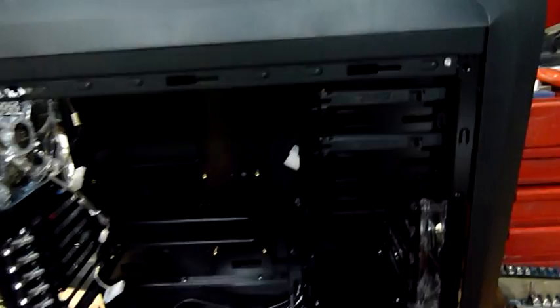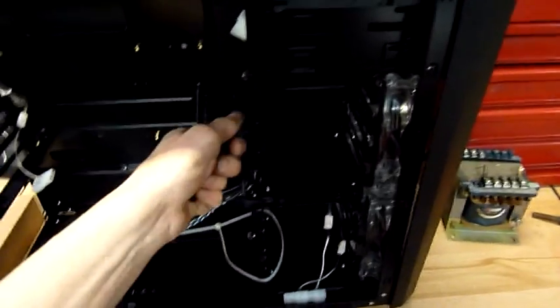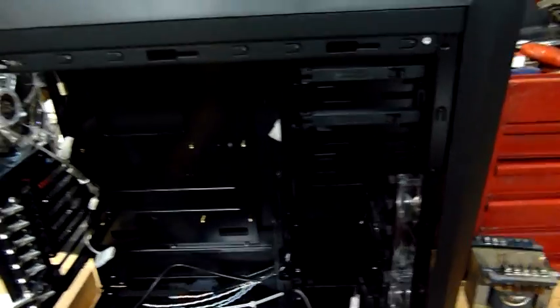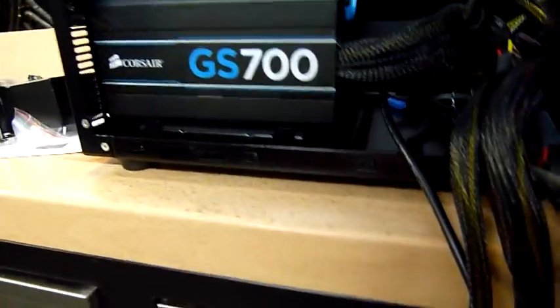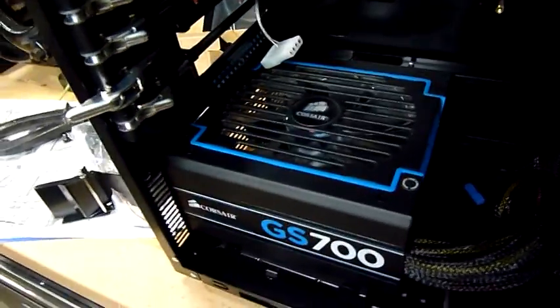It's power-supply-under-mainboard, so there's plenty of room for coolers. We've got all these big fans to pull heat out. I might just stick with air cooling for the time being and look at water cooling later. The power supply fits nicely, but I'm not too sold on the quick-release clamp — since there are provisions for screws in the back I'll use those. The fan draws air through slats in the bottom, but that's the only way air gets in, which is mediocre at best.